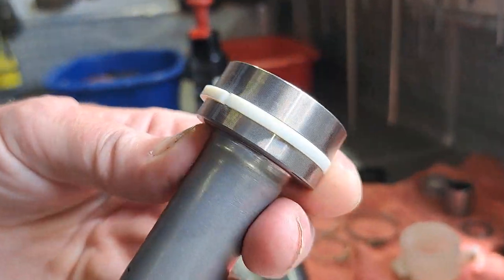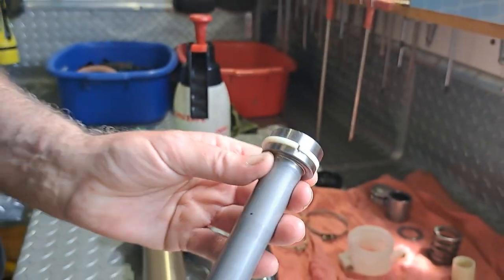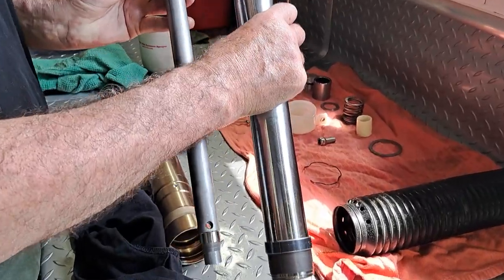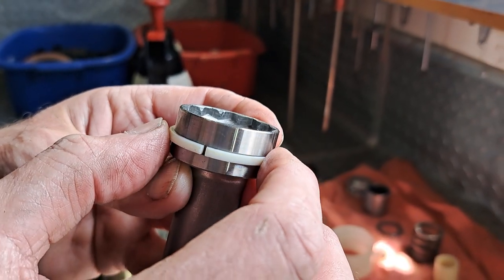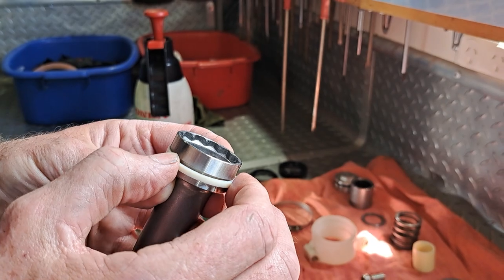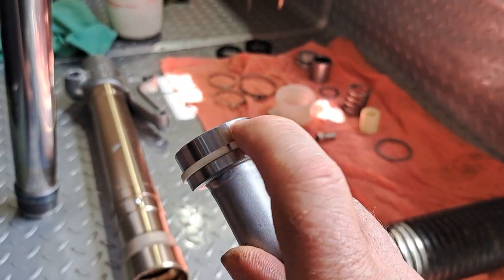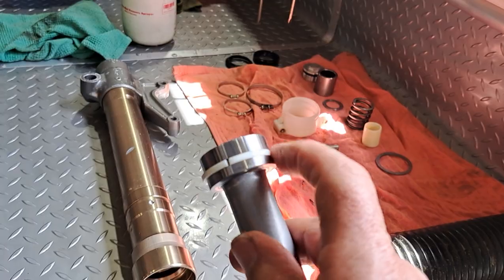So, as I was saying, Pete, this is the inner piston for the inner leg. That runs inside here and acts as a piston. And, of course, all pistons have a piston ring, so they've got a little nylon piston ring here. It's always good to check the integrity of this ring. 20,000 is okay, but over a period of time, I've seen these become paper thin or even disappear. So it's in good nick, but maybe at the next 20,000K when we pull these to bits, we'll inspect it, and may even just replace those while you get them out.